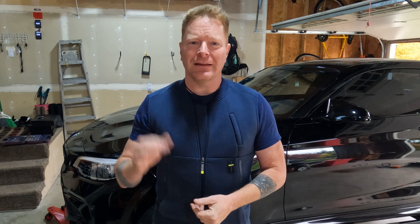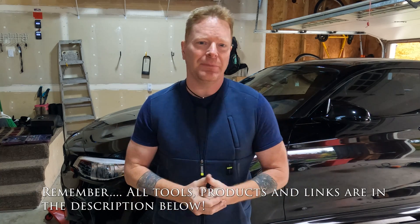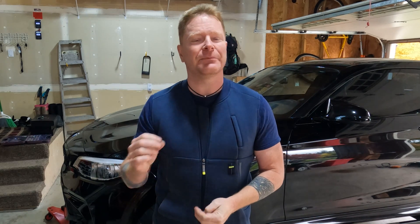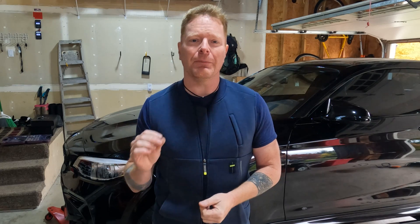Before we do this install, let's talk about the reasons why. Hopefully you've watched my part one, which is my turbo blanket install that replaces all of those drip shields with actual turbo blankets from Funk Motorsports. The other thing to look at is your downpipes, because they're right up against your turbos, directly underneath your engine bay on the left side of your motor, so that 1600-1700 degrees of temperature is all rising up directly into your intake pipes. Anything you can do to reduce your intake air temperature — your IATs — is better. I saw a study that shows for every 10 degrees of temperature, you either gain or lose 1% of power, depending on whether it's hotter or colder. So anything we can do to reduce those IATs is going to help power.